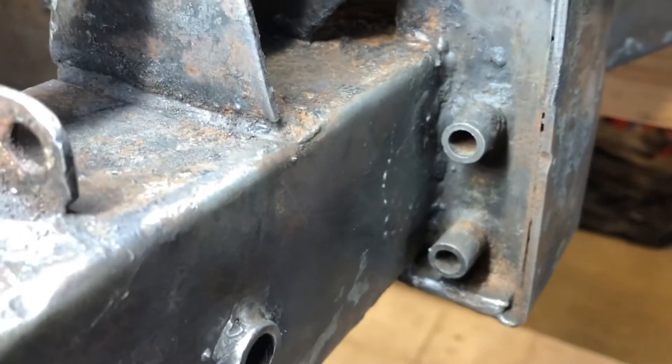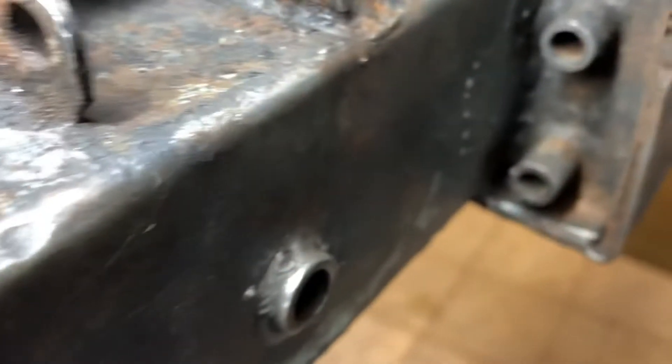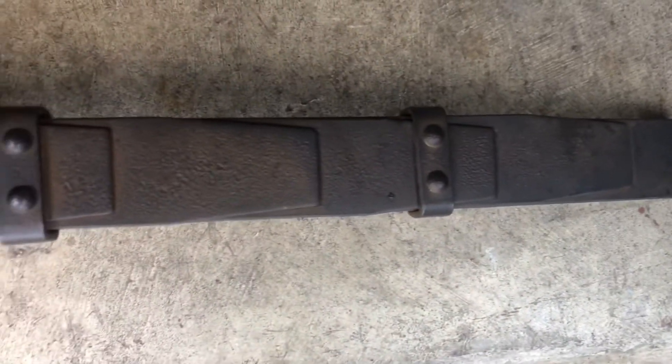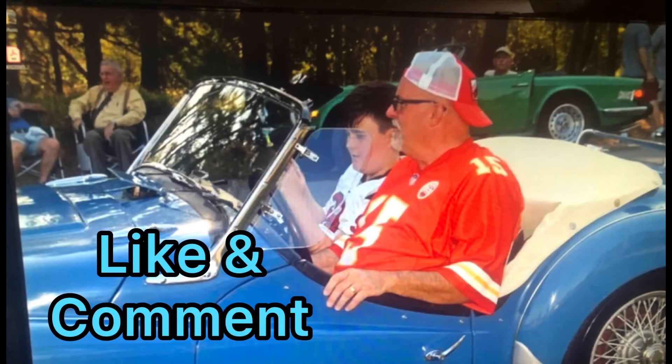I did a little more digging on this side just to see — I think I'm good. I did talk to the sandblaster about marking a few areas to go light on, and this is probably one of them, especially deep in that corner right there. Here's the last thing I've got: I've cleaned up one of the springs and it looks pretty good. I've got a buddy with a press who said he'd be more than happy to let me use it so I can take the bushes out and swap those over. I'll wire wheel the other one and then paint it.